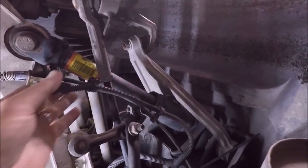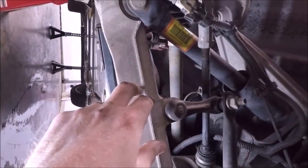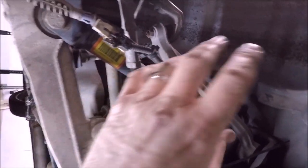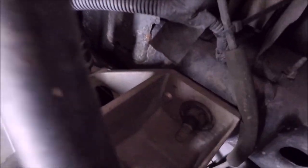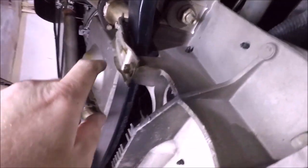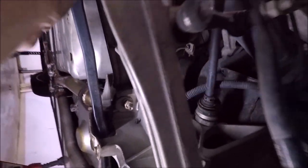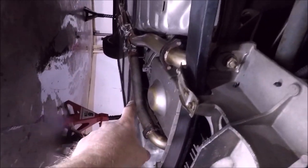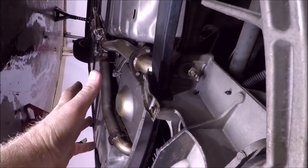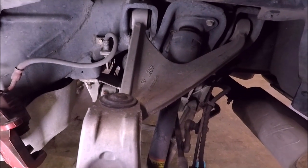The objective here is to take all the suspension and the rear cradle and try to drop it all as one solid unit. So the goal is to get everything that has to stay attached to the body — wiring, e-brake cable — taken loose from the cradle, and get all the suspension components taken loose from the body so they can all drop down with the cradle. The last thing we'll do is take the four large nuts off the cradle. We'll put our transmission jack under the center of the cradle and another jack under the transmission pan, then lower the cradle out.